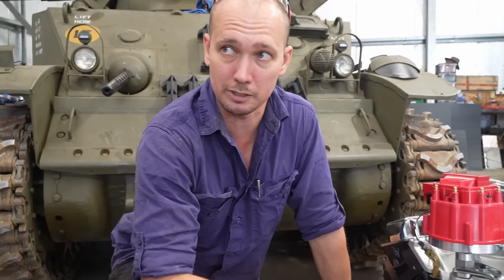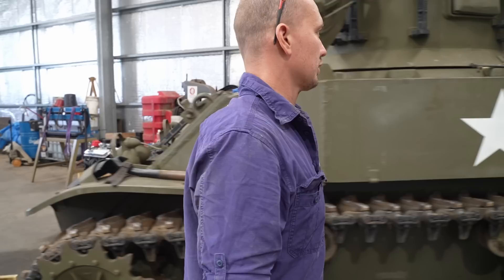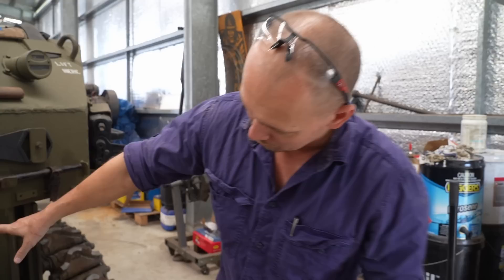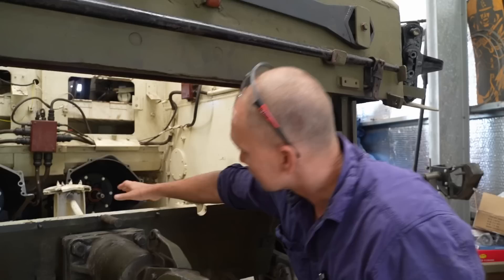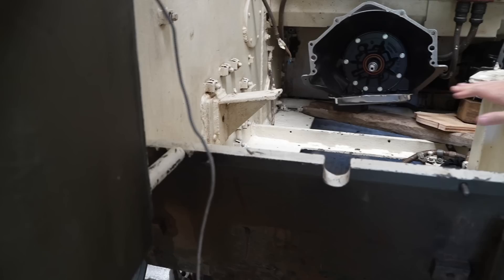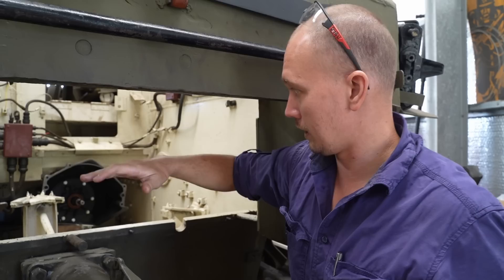It was too hard to try and adapt the old transmissions to these late model Chevs. Those old transmissions versus a Turbo 350 are almost identical in size so they fit quite well. So far we've been mocking up the transmissions and the new engines. We have the new transmissions sitting in place, we've modified the rear mounts to suit, and we've kept it the same as how these engines are originally fitted — on those slight angles. You can see the mount for one engine and the same on the other side, on the left, with the mount sitting flat on the transmission, bolted down at that angle.